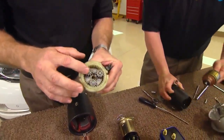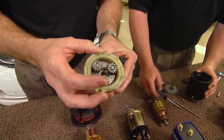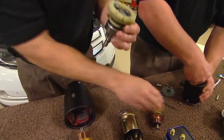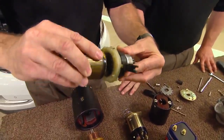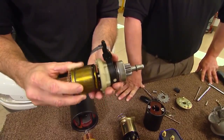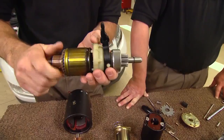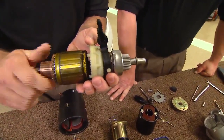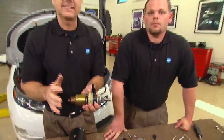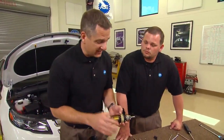This is a good look at a gear reduction starter — just like the solar system, we've got the planets spinning around a gear reduction right here. This is the ring and these are the little planets. I introduce this armature assembly, which is the sun gear. The armature spins — you can see I'm spinning the armature at about three, four, five times the rate, but that pinion is spinning a lot slower. What's that doing? It's developing torque — that's a high torque starter motor. A little bit different between the two, but the theory is still the same.